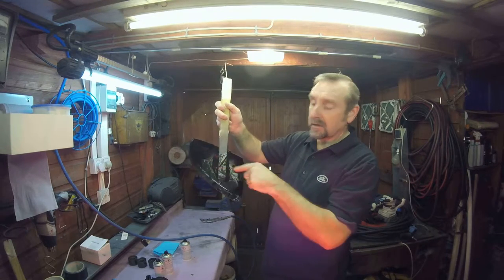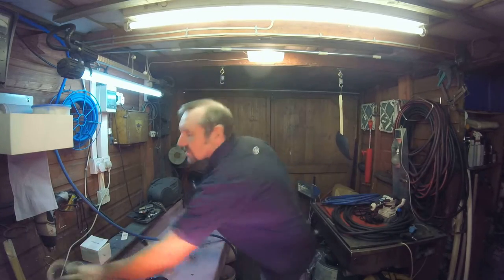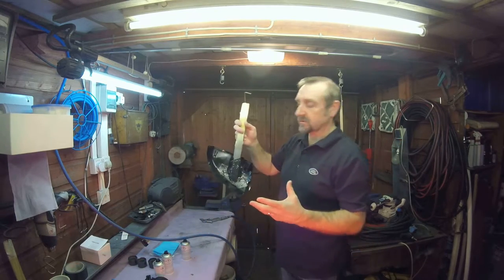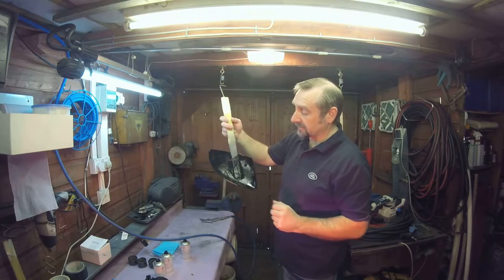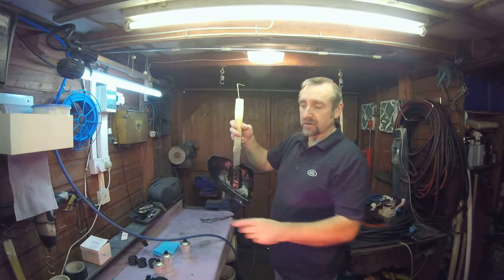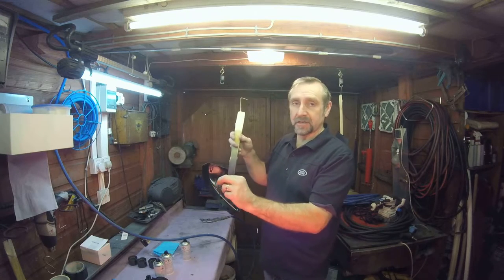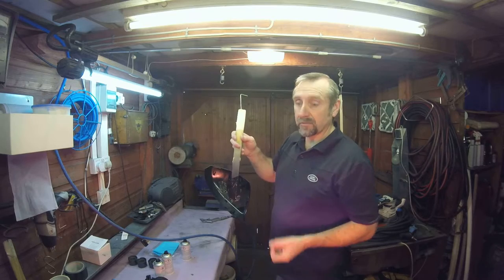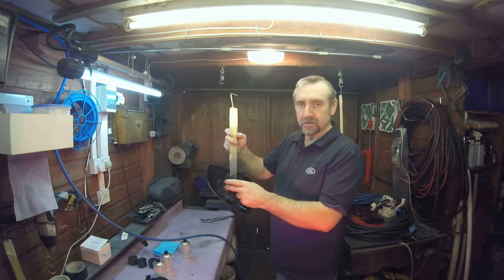Use duct tape when attaching a lollipop to a part. I've used masking tape before now, even the blue masking tape, and sometimes any heat that's in the room, or if I need to infrared cure these to dry them off, it'll attack the glue, because after all, masking tape is only meant as a temporary adhesive. The problem with that is sometimes the masking tape can come off when you don't want it to, so rather than this fall on the floor when it's nice and shiny, use duct tape.